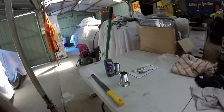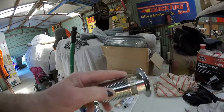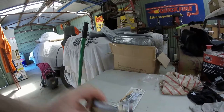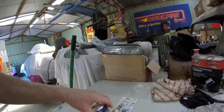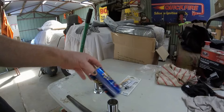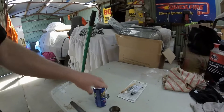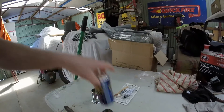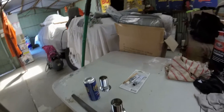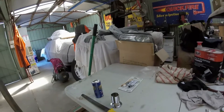I'm working on these drain plugs today, going to patch these up. I've started scoring up the area I want to cover. Got my aluminium can here — I can almost keep it in one band to go right around, which is great. The diameter is larger than what I need, so there'll only be one join rather than multiple joins. I'll get this one roughed up and mix up some two-part steel weld to commence sealing these up.